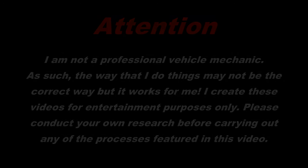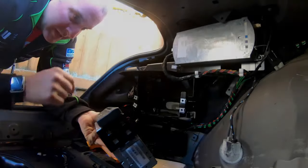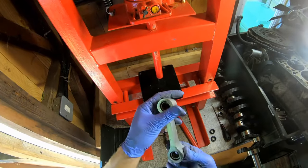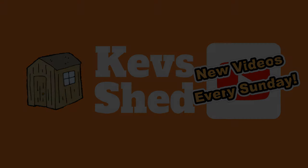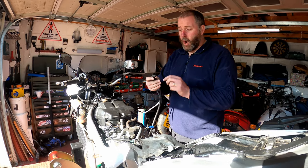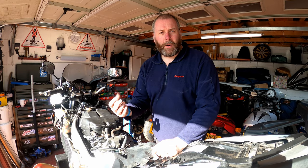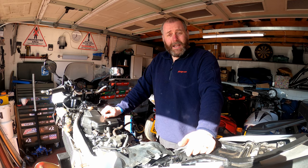Right guys, see you soon. Okay, so as you can see, we've got the panels off, we've got the tank off. I removed the tank completely from the bike. That involved removing the breather hose and the overflow for the tank, disconnecting the electrical connectors and also removing both the return and feed fuel lines from the fuel pump, which is obviously at the bottom of the tank. Now the high pressure line is a hex head banjo bolt which needs to be undone and there is an aluminium washer either side.